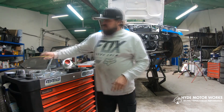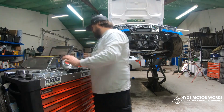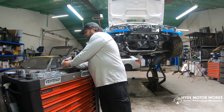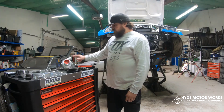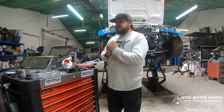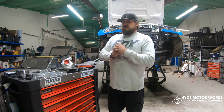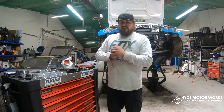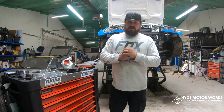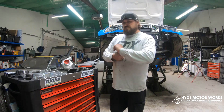There is also an 8PK belt that comes with this kit. And last but not least, a Rotrex C30-94 supercharger. The pulley we've made for this kit is a 120mm pulley, and on the supercharger we're going to be using an 80mm pulley, which gives us clearance within the rev limit range of the Rotrex supercharger. Depending on which supercharger you use, you're going to have to check with Rotrex to see where your RPM range is and then choose a pulley for your supercharger accordingly. Everything in this kit will be available to buy on Hyde Moto Works' website later this year.